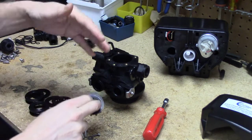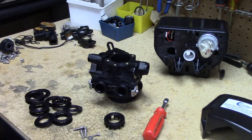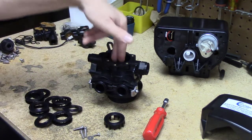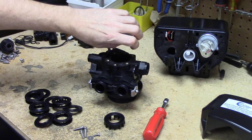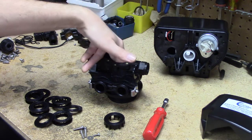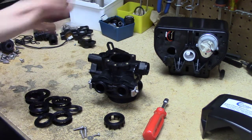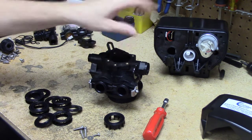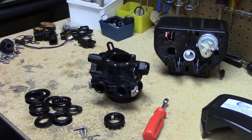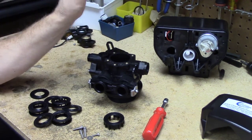When you have the valve open and there's a lot of iron rust in there, take some white vinegar, pour it in, and stick a paper towel in there to let it all wick up. If you've got really bad iron, let that soak for a couple of hours, then come back and wipe it all off and rinse it out. Then you're ready to redo the seal and spacer stack.